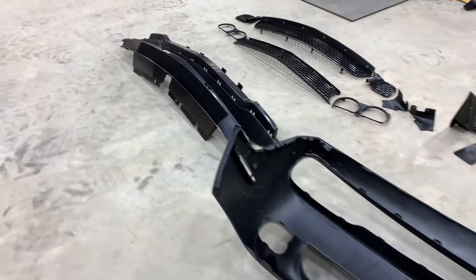I know a lot of you might be wondering why I didn't get the front bumper painted first before putting it together. You always want to test-fit your pieces before you get them painted, because it would suck to get it painted and then have to grind or sand something down — that just ruins the paint. Also, in order to put the wide body on, that front flare that goes next to the reflector is really important because it lines up the rest of the flare for the front fenders.